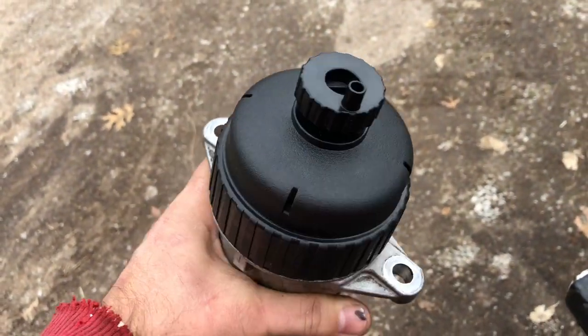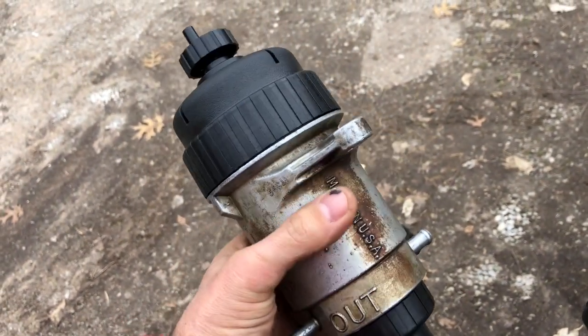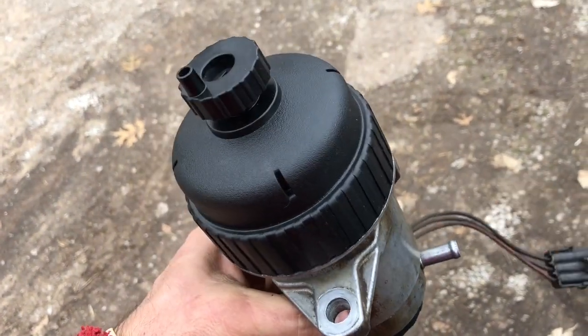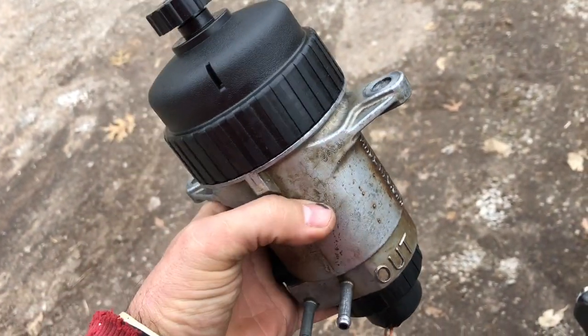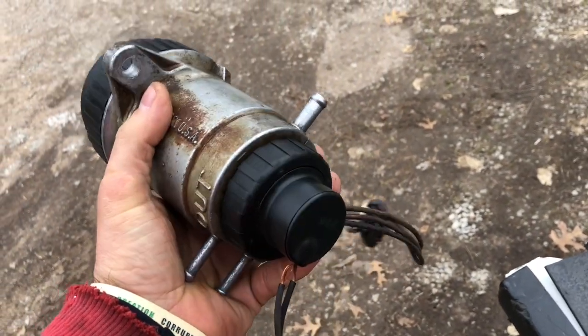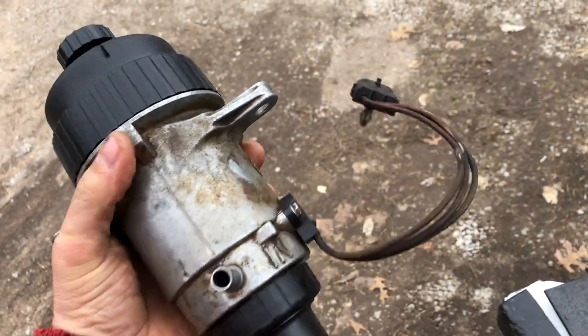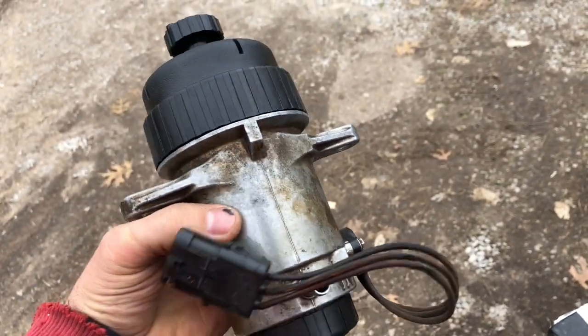Six five guys, I'm sure this looks familiar to you. We've got the fuel filter manager here — it's outside the truck. We've got the inlet right there in three-eighths, and then we've got the outlet and the drain right there in quarter. Fuel heater on the bottom here and then a sensor for water in the fuel off to the side there.